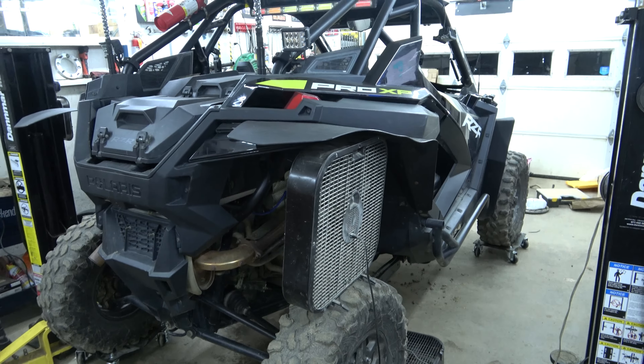While we're at it, let's throw the hood back on. Okay, now no air can possibly get in through the nose. We're going to put some sticky foam tape right along this edge, so I've got some isopropyl alcohol to clean this up. I've placed the driver's side shroud where it's going to go so I can put the seal under there and tape it in place. There's the end result — that'll work, could have gone up a little more on the front one but it'll be fine.